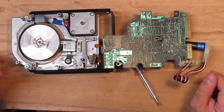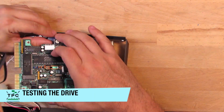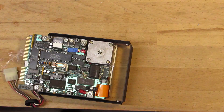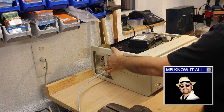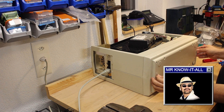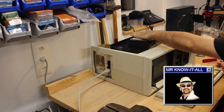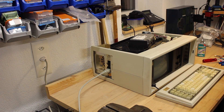I was then also adding a drip of oil and let it stay for a night. The day after, I was reassembling everything again and connecting the hard drive on the fly. You really believe this should be working now? I don't know. I'll power it up. It spins up! It's unbelievable! It spins up! So it was just stuck on a spindle! Can it be as simple as that?